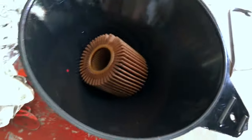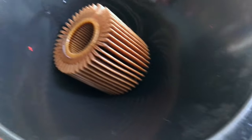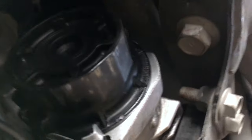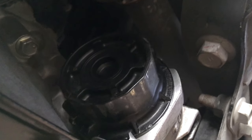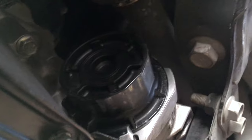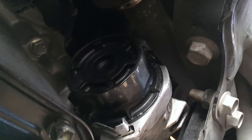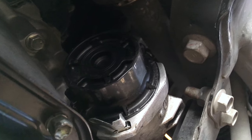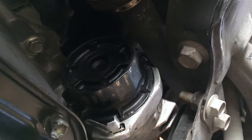Just wiggle it out — pull it out like that — and set it in a funnel on an angle on top of an oil recycling container. That allows gravity to extract all the remaining motor oil from the filter. Now you're gonna snug the new filter down — 17 foot-pounds is the specification — and make sure to reinstall the safety clip. You'll feel when the o-ring starts squeaking; just put a thin film of oil on there and that'll help it slide in. No more than 17 foot-pounds per the manual. It was obviously over-tightened and took an extraordinary amount of impact wrench hammering to get it back off, but incredibly the plastic housing did not break — so two thumbs up to Toyota for making it out of some really tough plastic. Thanks for watching, cheers guys!